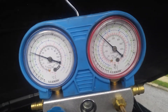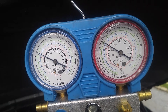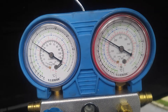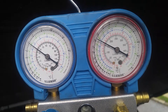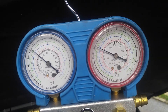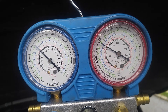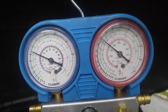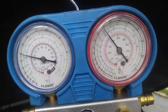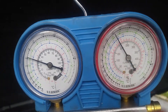Okay so again 75 degrees ambient. My high pressure is quite low right now, and the AC compressor has been shut down because the evaporator is freezing. On a hot day the pressure can reach up to 350 — I've seen that happen. Now the AC compressor has kicked in and high pressure is going up to about 200. Again, it's a cold day.